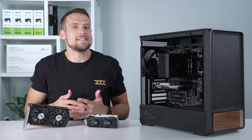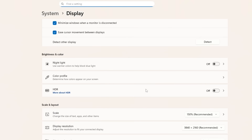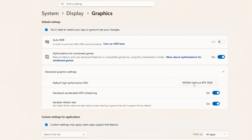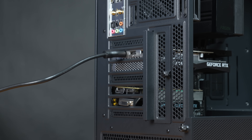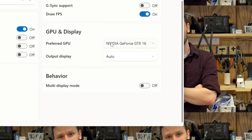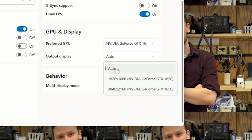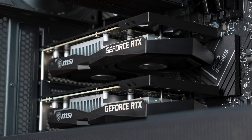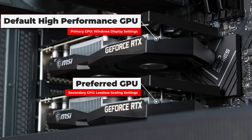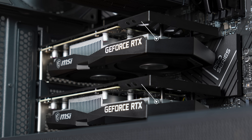Make sure you go into Windows Display Settings → Graphics → Advanced Graphics and set the default high performance GPU to your main GPU. If you're going to try a dual GPU setup, plug your monitor cables into the secondary GPU. In lossless scaling, set the secondary or frame gen GPU as your preferred GPU, and the one below can be set to auto. Even though we're plugged into the secondary GPU, the processing power still mostly comes from the primary — only the lossless scaling frame gen and scaling comes from the secondary one.